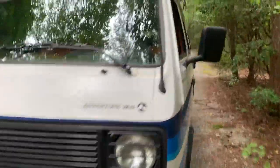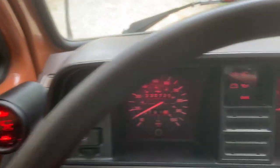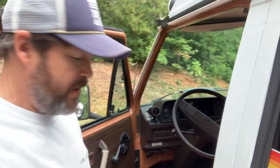Time to go for a test run. We're at idle here, reading eight. We are at temperature. Going down the hill, 54 PSI. I don't have a tachometer so I don't know exactly what I'm running. 24 PSI headed up a hill — that's about 30 miles an hour. Done with the test drive. I would say the average reading I got was in the upper 20s range. Going downhill at idle, I was at a low of eight. My high was around upper 40s. Average around the 20s, which from what I've read on the Samba seems to be about correct. I'm kind of pleased with that.